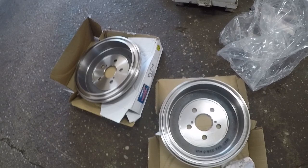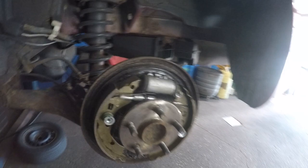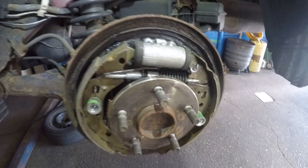It's time to put the drum on and adjust it, so there are a few little things you want to pay attention to. Your adjustment screw — all you need is a flat head screwdriver. What I like to do is do three clicks. Let me turn on my light. One, two, three.